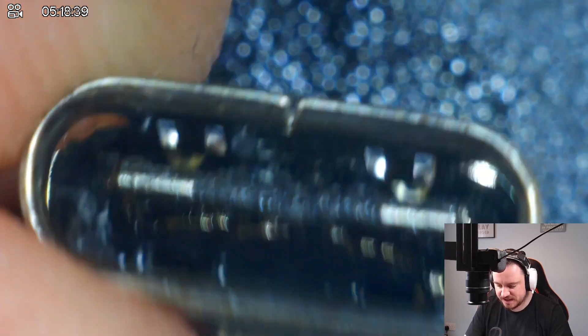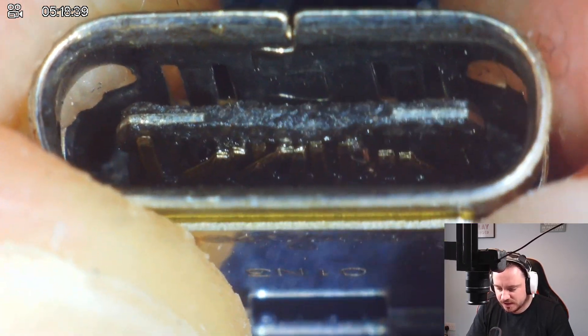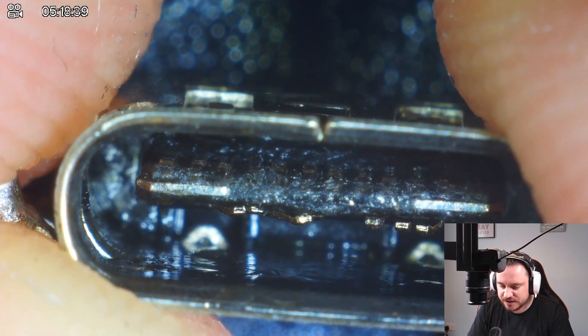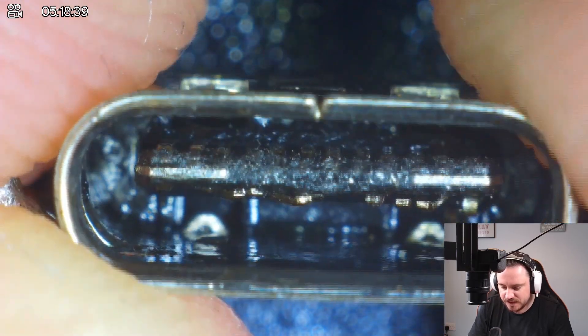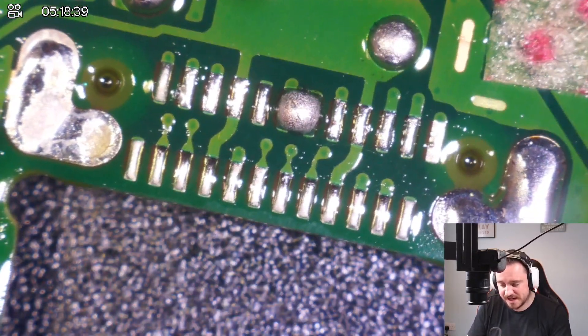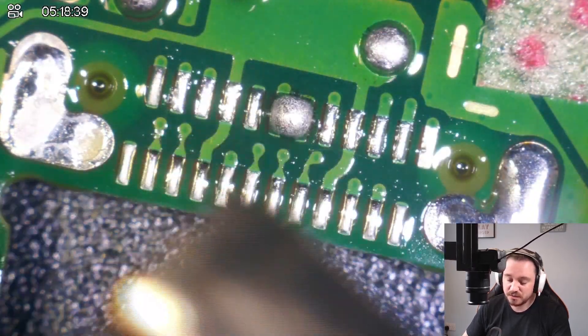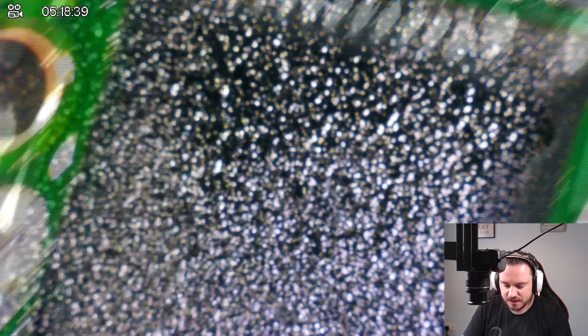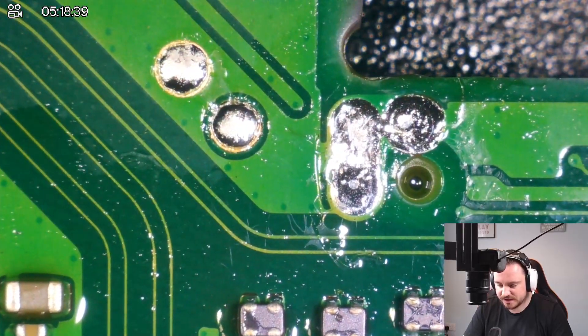We're going to check the status of the pads on the board. First, look at the inside of the removed port — the bottom side looks horrendous, which is why it was only charging on one side. Many of the pins are touching together. The other side where it was somewhat charging looks comparatively okay. Good news: there are no ripped pads whatsoever on the board. I used quite a small nozzle and moved the air around quickly. Checking the other side of the board and the filters — everything looks good, all the holes are clear.